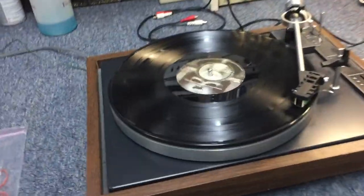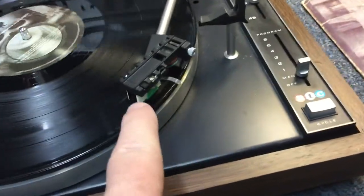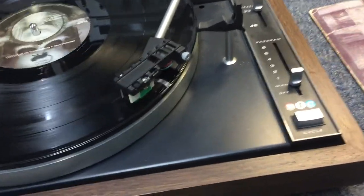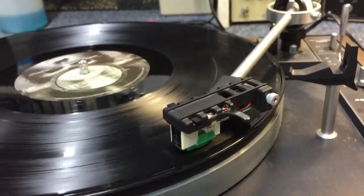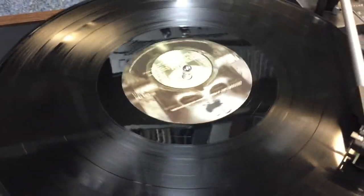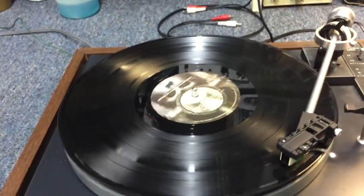We're going to fast forward about a week. I had a chance to get a new belt — actually I believe it's a used belt — and the same person that sold me the belt was nice enough to sell me the E-clip for the platter. The P-mount that I have doesn't work with that adapter very well, so what I decided to do was take the Audio-Technica from my garage turntable and mount that here. With our substitute belt, the turntable is moving along very well, sounding very good, and there's not even much of a speed issue. This is sounding real nice.